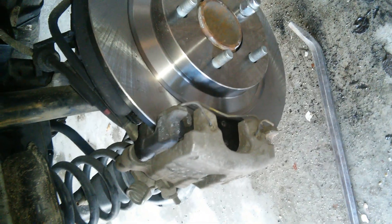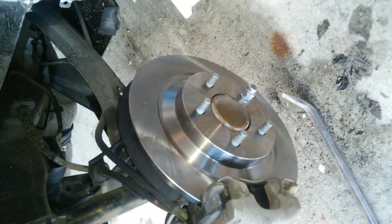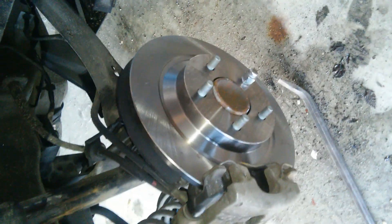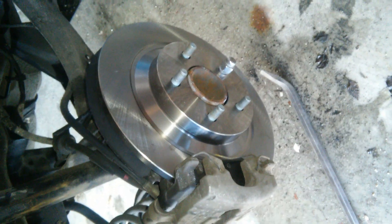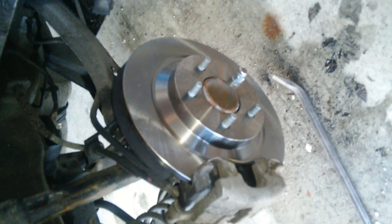While you get your caliper set back in place, take the lug nut off, put your wheel back on, drop it down, and go for a drive. Remember to tap your brakes a couple of times before you go too fast — you want to make sure your caliper is working properly. One last thing: when you start, you may want to crack the cap on your brake fluid reservoir, because when you compress that piston the fluid is going to back up into the reservoir. If there is any back pressure it may cause a little grief as you try and do that. That's about it — enjoy your Mazda 5!